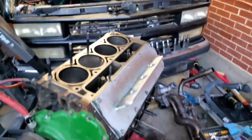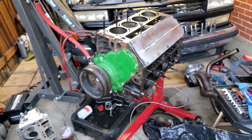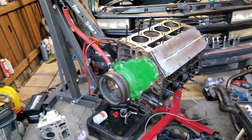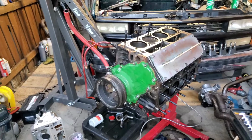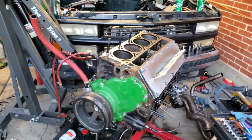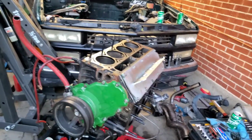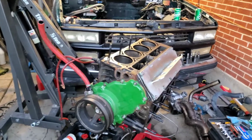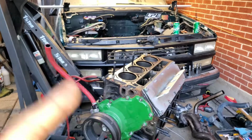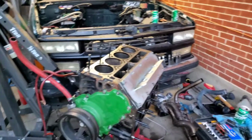I am going to do a flush on it, so as soon as I turn it on, I'm going to buy a cheap oil, run it, flush everything out, and then put some good oil back in there, and let's really hope that she idles better and runs better, because like I said, it had a weird idle. It just didn't sound the way it used to, but whenever I would drive it, it seemed perfect, you know.